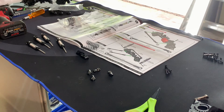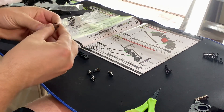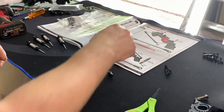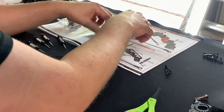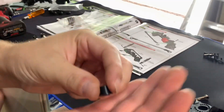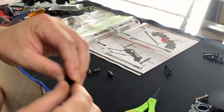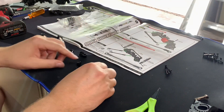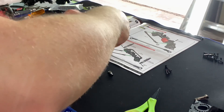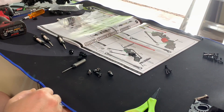We're back doing shocks. I went ahead and got my mod done — he wanted all soft springs, so this is the new spring we use for our kits. This is a Deluxe all-black spring that a lot of people requested, so I sourced them. We now use a Deluxe Delrin lower cup instead of 3D printed parts, and I mod it to fit the TRX lower shock rod end. It's a 7mm versus the older 6mm. I'll only do one shock to show you how these go together.